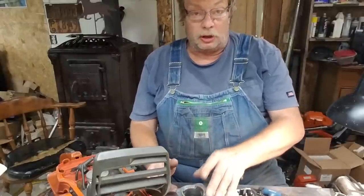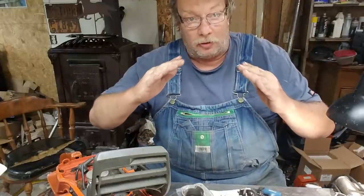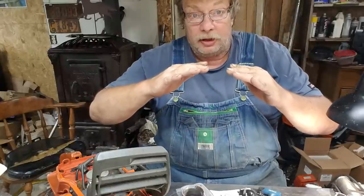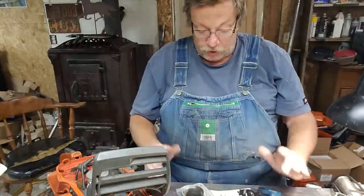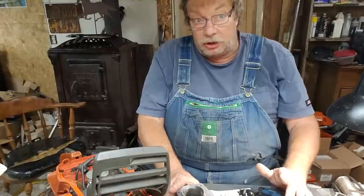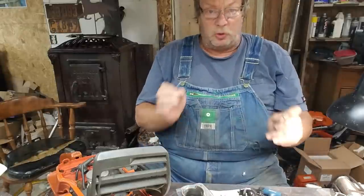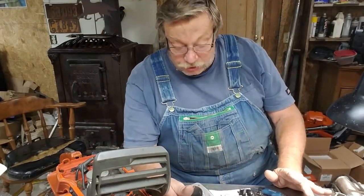But most importantly, on the primaries, I got a slightly steeper angle above the piston for airflow. And then the secondaries are more toward the back above the intake and a little shallower. By reading the carbon print on these saws that I take back apart, I'm finding that sweet spot, and I'm starting to get some impressions of what I can do better.